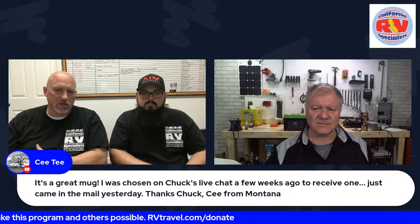So we don't want you to damage, especially if you have a big Class A motorhome, you have an inverter and converter that are several thousands of dollars. We don't want you to ruin those. So if you're going to plug it in all the time at your house, whether you're storing it, running a dehumidifier or a fan in it, or just keeping it plugged in to keep stuff in your refrigerator cool as a secondary refrigerator, once a month, go out, unplug the power, turn it on for 3, 4, 5 hours, drain the batteries down as if you're dry camping, and then plug it back in and let it charge back up.